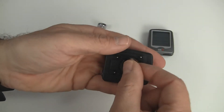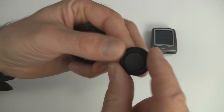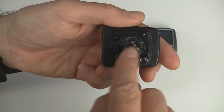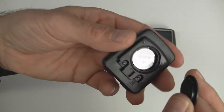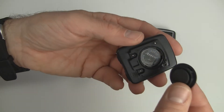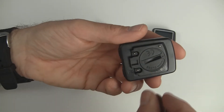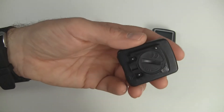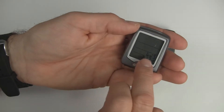Once you have a new battery, pop it in and push it in. Before putting the cap back on, inspect the inside of the cap to make sure it's clean with no dirt — sometimes grime builds up. Make sure the little black rubber seal is seated properly and the surface is clean. If the surfaces are dirty when you put the cap back on, the unit may not be waterproof. Put the cap on so it seats flat, then turn it about a third of a turn until it stops and locks. Check the front display for flashing digits to confirm the battery is good.